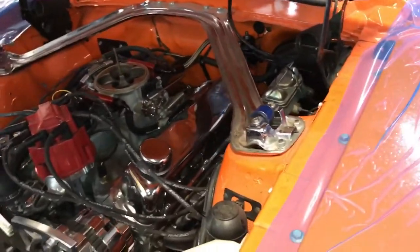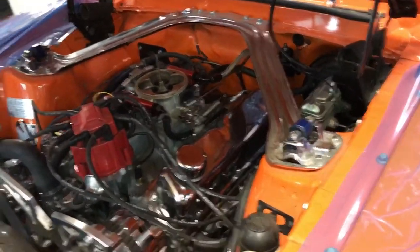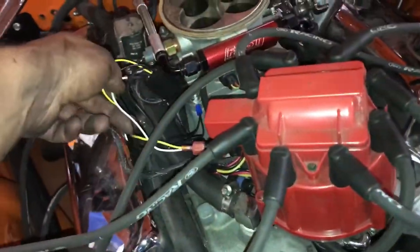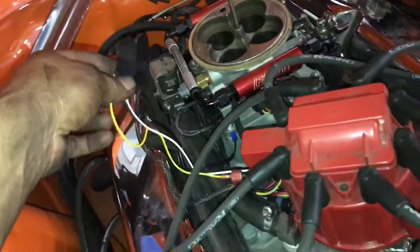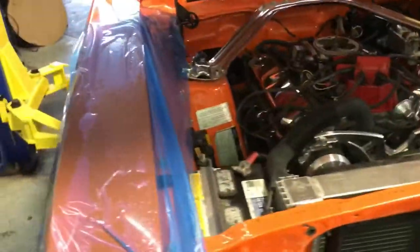14.6. It doesn't smell. Before, it was pig rich. I mean, they hadn't put this. I got to clean this up here. The resistor here for the tach signal for the ECU, it's basically just a small little resistor. I know it's all loose here, but I'm going to fix it up now and finish the car. But this is basically done. It's ready for a test drive.